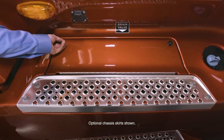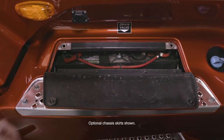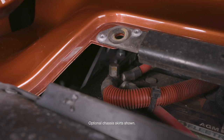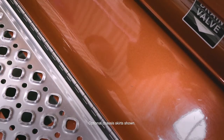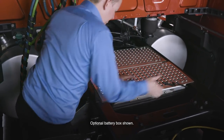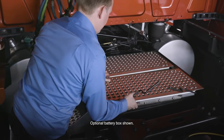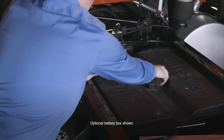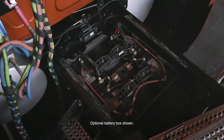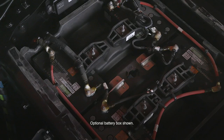To inspect batteries, lift the battery access panel on the chassis skirt. Battery terminals should be clean and connections should be tight. Green discoloration should not be present. Close the access panel. If any issues are found, contact your maintenance provider. To inspect optional batteries between frame rails, push down on the quick release handles to remove the deck plate. Push down and turn the locking cap and remove the battery box cover. Battery terminals should be clean and connections should be tight. Green discoloration should not be present.